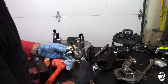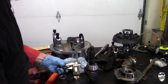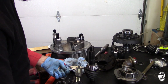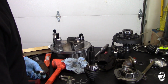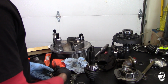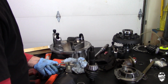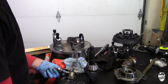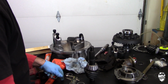And we are at, this is where the math comes in here, 12.33, and this one is 11.33. So we need a 1. So at least want to start with what this factory style shim is, and then we can back off after that. So 12.4, so we're 0.1 higher actually. 3, so super close.